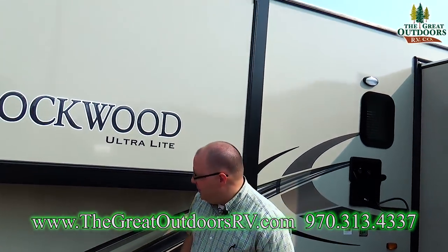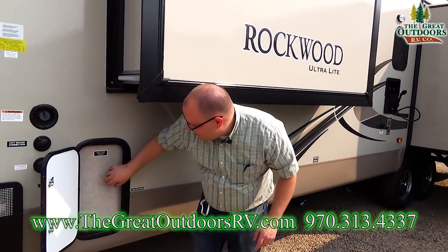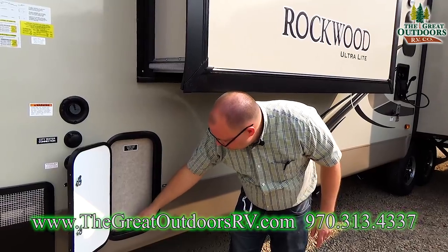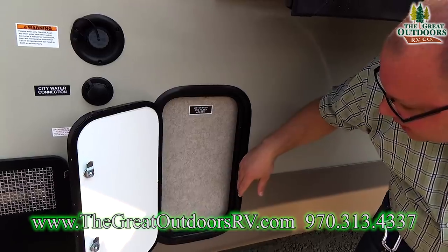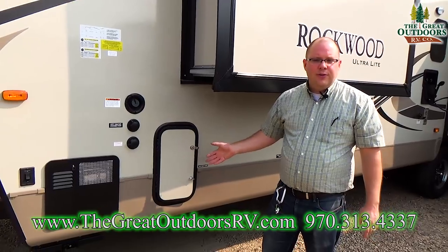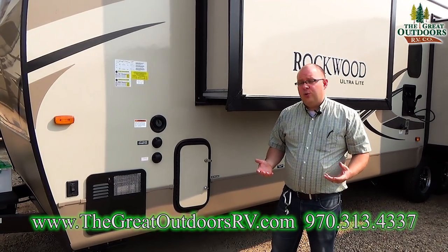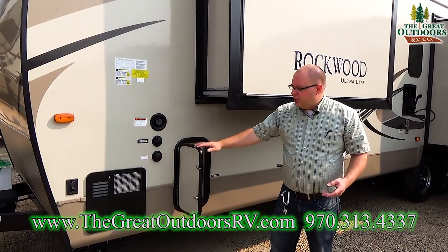Here's the wardrobe slide. This access panel — held by just one screw — leads to your water pump system and filtration system. Remove that panel and there's a water pump you can access for maintenance. There's also a water filter: this coach features a 10,000-gallon water filtration system down to 0.9 microns, residential grade. When you need to swap it out, remove that panel, pop a new filter in, and you're good to go.